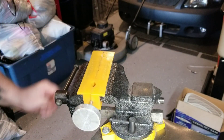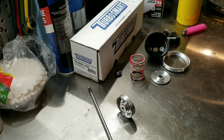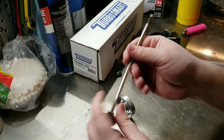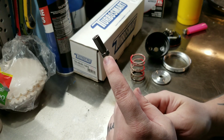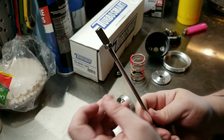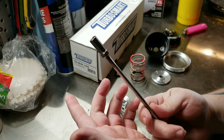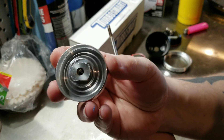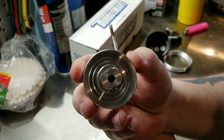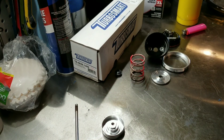I paused and got it taken apart. Even with the Loctite softened it was tough, so what you can do is grab a jam nut or take the clevis that comes with the wastegate, thread two nuts together and lock them onto the rod shaft, then spin it off. There's a wrench flat on the piece — I think it's around 15mm — and that works perfectly.